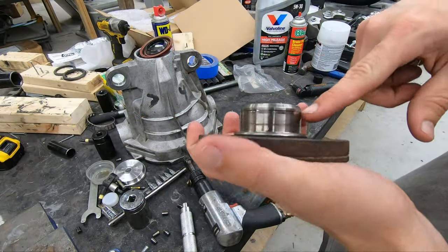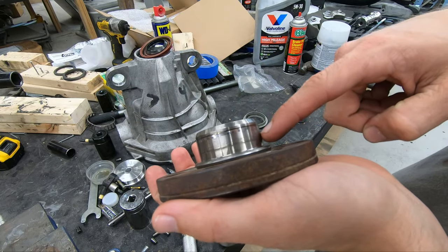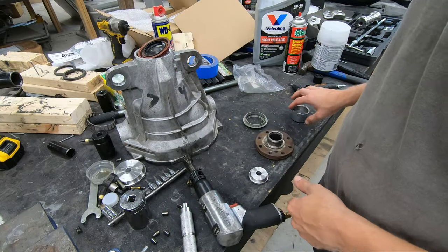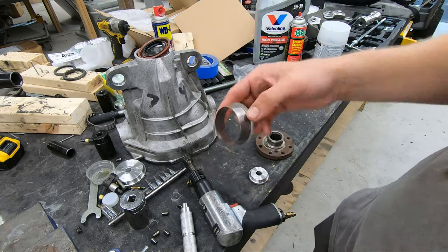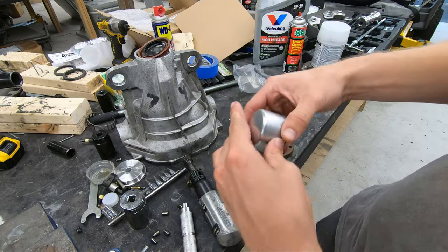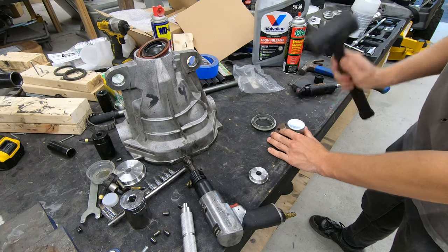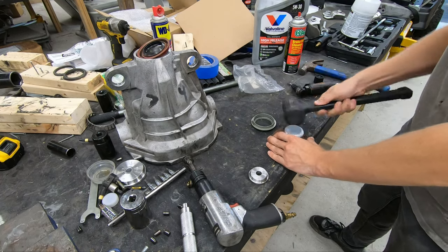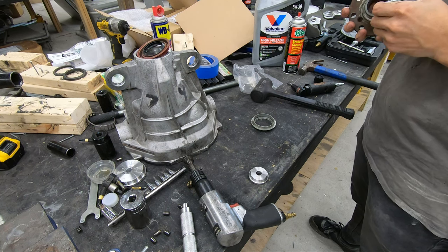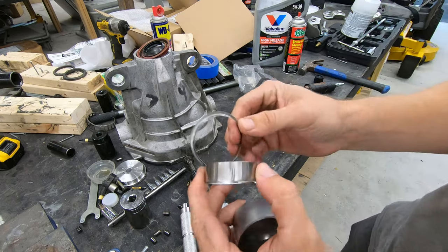Finally back with the right tools. Starting with the flange — there's a groove on the flange surface which I think was causing the oil leak out of the front of the pinion. I went ahead and got a repair sleeve instead of spending $150 on a whole new flange. It basically comes with a little cap — you set it on there and whack it down. Of course, it didn't work correctly. That was great. I just broke it.